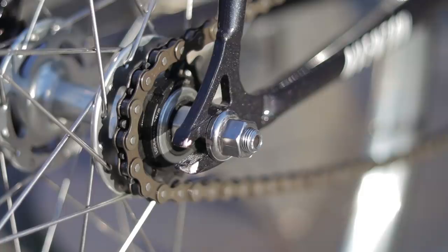Aventon didn't spec the RD2s with the matching bottom bracket. To get a perfectly straight chainline with the RD2s, they accept a 103mm bottom bracket spindle, whereas Aventon specced the Andreas with a 107mm bottom bracket spindle, meaning the chainline could be straighter. I didn't measure the chainline though, and I didn't have any issues with drivetrain smoothness. But in the long term, a less than perfect chainline may lead to the drivetrain components wearing down faster. Let me know in the comments if you have an Aventon Andreas and if you've had any issues with chainline.